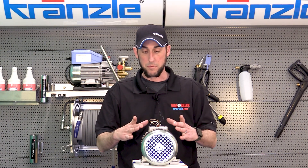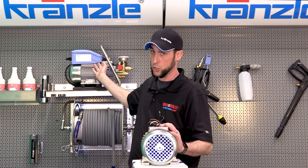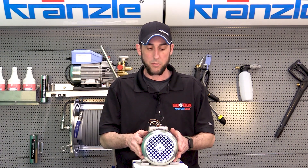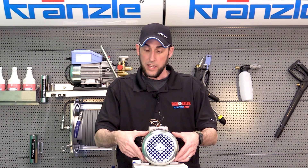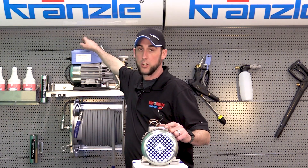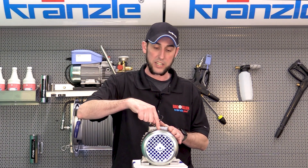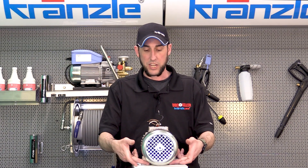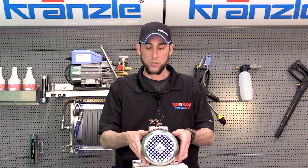We've removed the electrical enclosure from this particular housing. I imagine if you dropped it, some of that might be broken too. The older models had the fins — you may see them in some of our previous videos. They bolt down onto the motor housing, and it can be a little bit challenging to get this off without at least loosening that up. In the newer one, you can remove the screw just by getting inside the enclosure. With the older ones with the fins, sometimes you have to loosen up the housing all the way and turn it to get the final screw out. You can take out your bottom screw and your two side screws first, and then if you can wiggle it off, all well and good — but you'll probably have to loosen up the enclosure so that it will shift off.